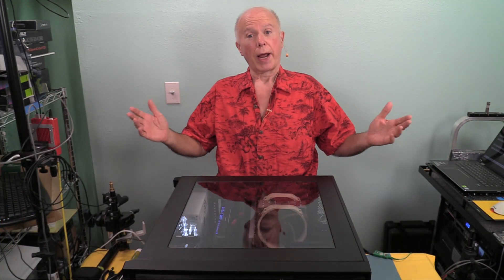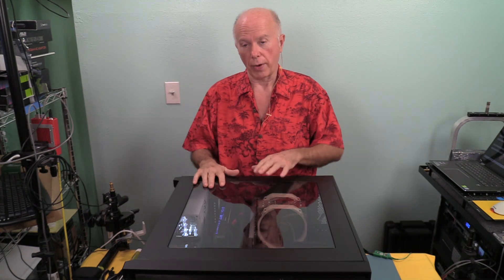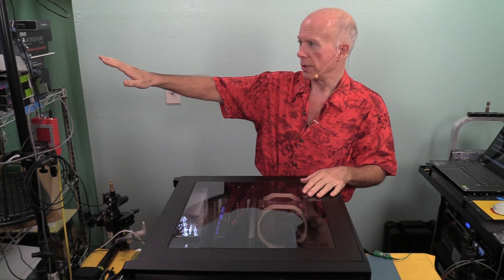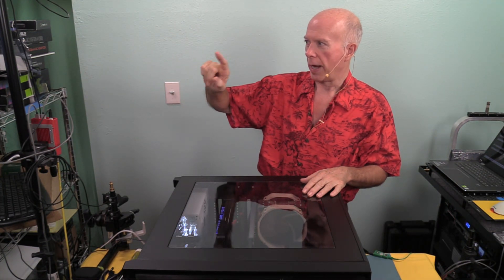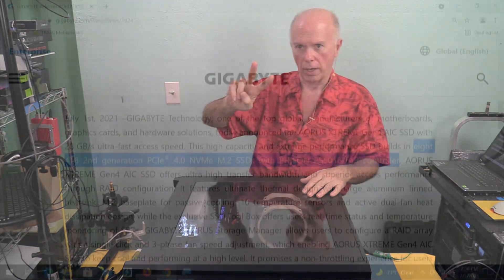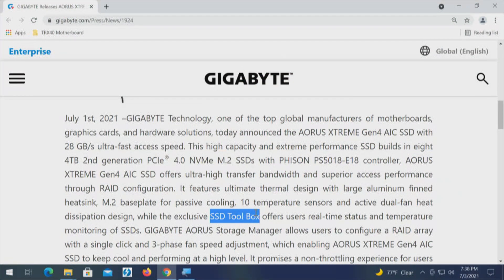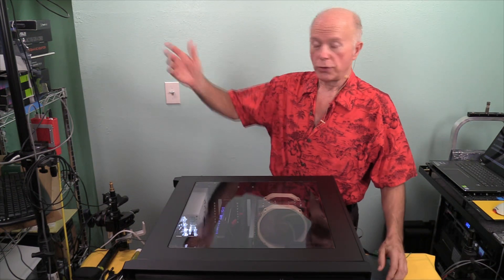This is not a real RAID card — it's what I call a poor man's RAID, because there are different levels of RAID and we'll probably do another video about that. As it relates to this card, there are also 10 temperature sensors on here. There are two pieces of software: one to check the thermistors, which requires the SSD toolbox, and number two, the Gigabyte Aorus Storage Manager, from which you can create the RAID.